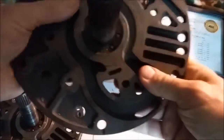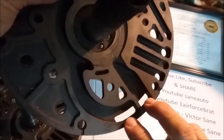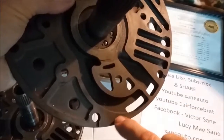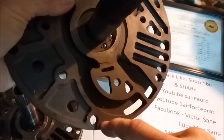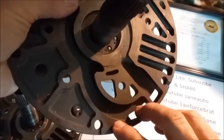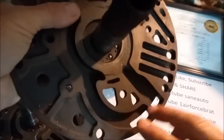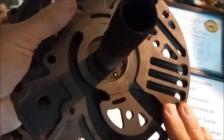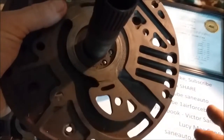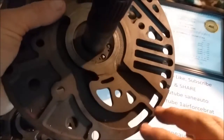For the 14-hole one, you see right here, you have two fluid ports. On the 14-hole, you'll have another fluid port here where they've carved out this metal and put another hole, so more fluid can flow through. You'll have a total of three fluid ports — that would be your 14-hole stator. So when it looks like this with two fluid ports, that's a 13-hole stator. If you have three fluid ports, it's a 14-hole stator.